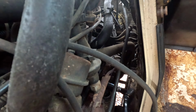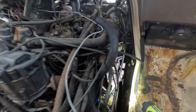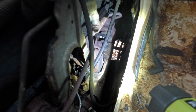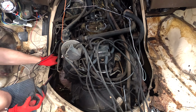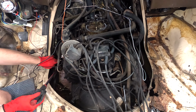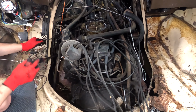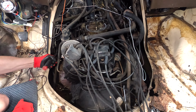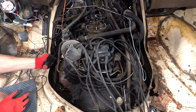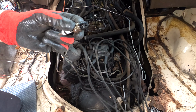Okay, let's check this, see how this one's gonna look. Yep. I mean, it was snug. That was about it. It was just snug. All right, cool. Makes it easier to get these things off and then not being seized on, so hey. Man, that looks loose. That one looks a little snug. Well, it is a possibility these things are running a little rich. A little black there, but...